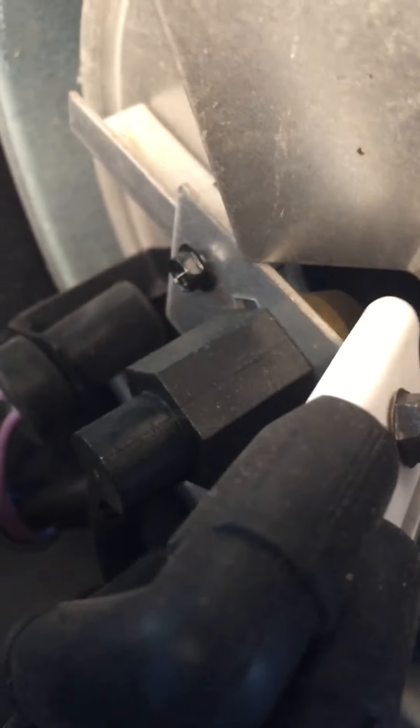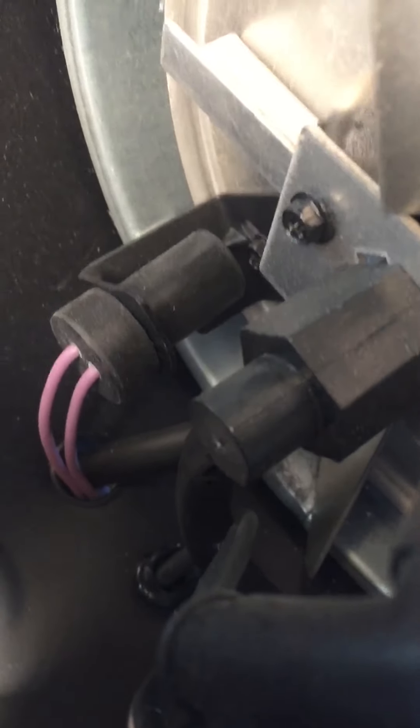There's a lot of things in here. This is where it goes in — this is fuel on it. If you don't look, it's hard to see. That thing is going into there and it's split, and also split where it goes into the fuel filter. See how dry and split it is? I'm going to change that and put a regular rubber gas line on it.